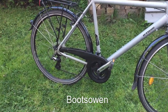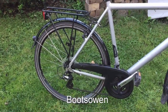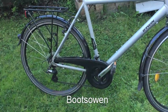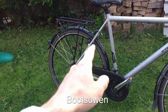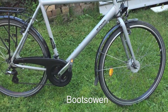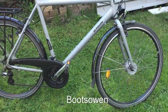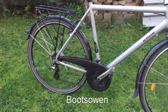The back wheel on it is really bad, and I'll show you that in close-up and spin it around. The bearings and freewheel - he told me the freewheel isn't engaging, but I've since identified that the bearings are knackered. Back brakes are loose, front brakes are just awful - nothing in them at all, and I think it needs new pads. It's got a dynamo hub, but the headlamp's broken off. So I'm going to have a go at it and see what's in the back wheel, because I think it's a nice bike.